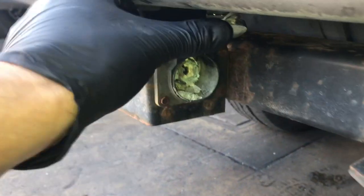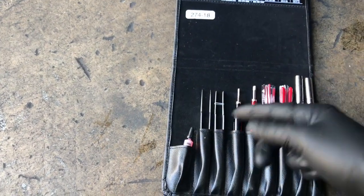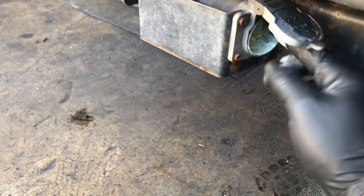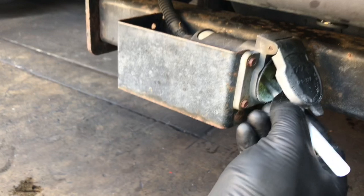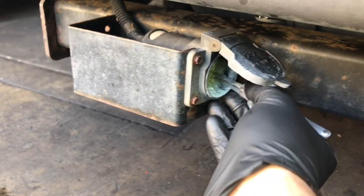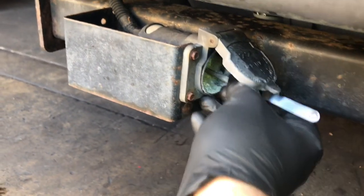Now I'll show you how the tool works on trailer hitches, where you can get lots of typical corrosion, as you can see on this one here. I'll go through the kit to find what tool works best and start cleaning this out. In this case I would actually replace this terminal — it's pretty far gone — but I just wanted to demonstrate how the tool can help clean pins like this. I'm using the tweezer tool again, the bigger size, squeezing down and filing back and forth.